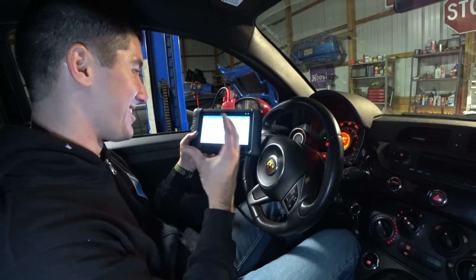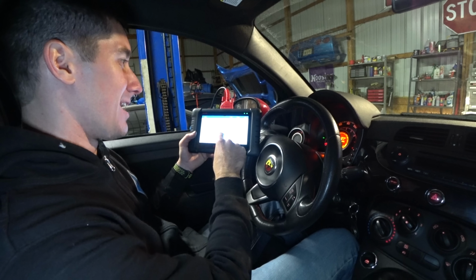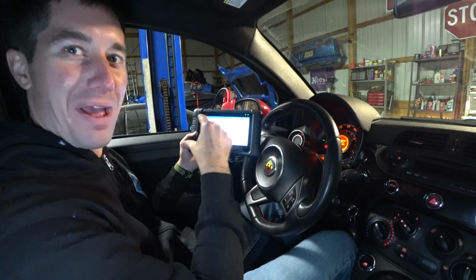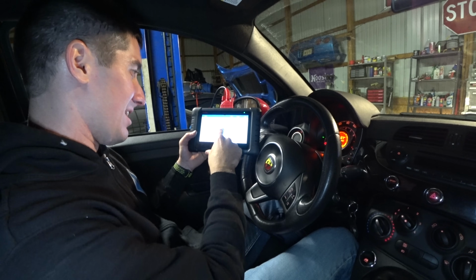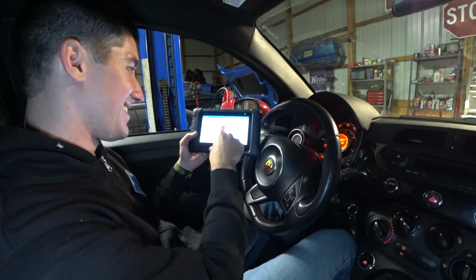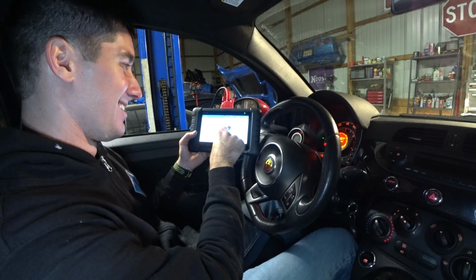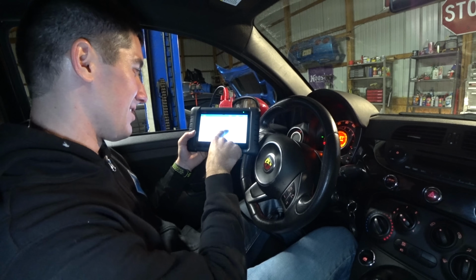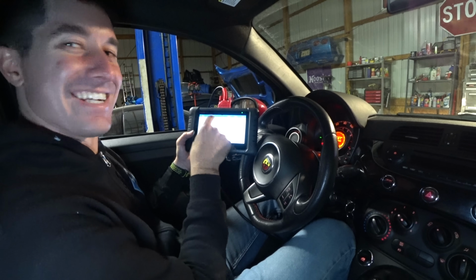The live data is so awesome. Map vacuum, 290 millibar. We can see the actual voltage from every sensor, like the map sensor there, barometric, throttle position sensor, and the voltage driving it. That's just insanity. Throttle blade percentage. Man, 50% gets nasty on this car. It's so cool. Accelerator pedal. That thing's so good. It's so fast.